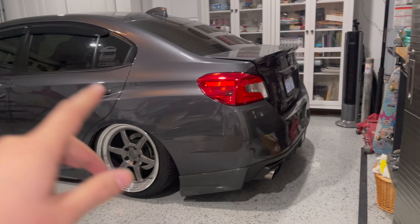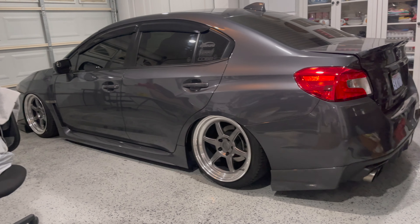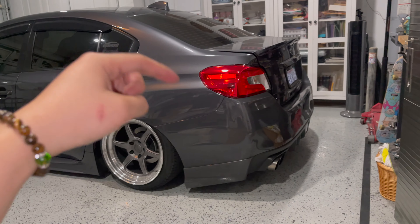There we have it guys - the tubes are nice and shrunken, the wires are connected, the module is connected. Just to make it clear: the outlet goes connected towards the fourth brake light, the inlet goes towards the taillights. It doesn't flicker like crazy, but it's way better than not blinking at all. Honestly, it looks pretty cool. I'll put the link for the GS100A in the description below. Since I have another module, I'm going to do the same to the third brake light.